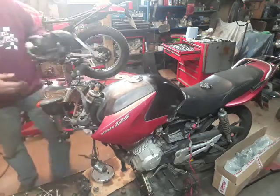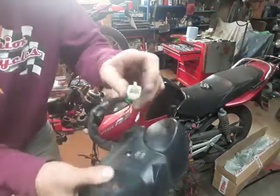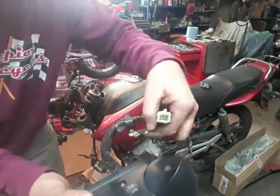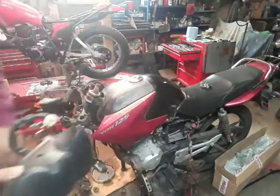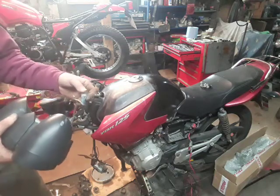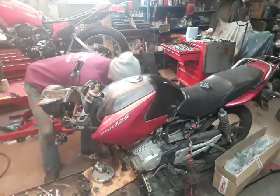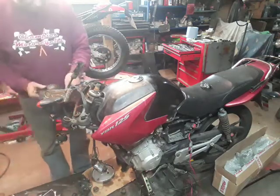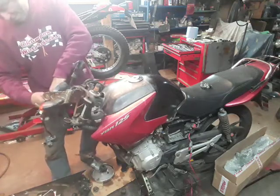So there we go. When you're stripping down, you'll find there's one block connector, blue wire with a male fitting, yellow wire with a male fitting, green wire male fitting, brown wire male fitting. It's simple. Same thing when you slot it back in, you find the appropriate same coloured wires, connect them together, and it works. Swapping components is as simple as that when you have a wiring fault and you have to diagnose it.